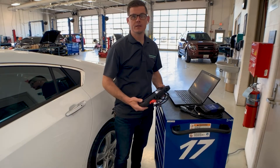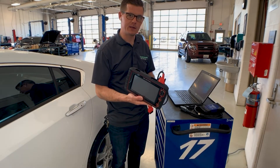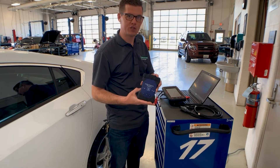Next, we're going to get a scan tool out and look at what kind of PIDs we can see, and whether we can recognize a bad key based on scan tool data. I've got the Snap-on and I've also got a GM MDI 2, so we'll see what the OE level tool can show us in terms of immobilizer data alongside the Snap-on tool.